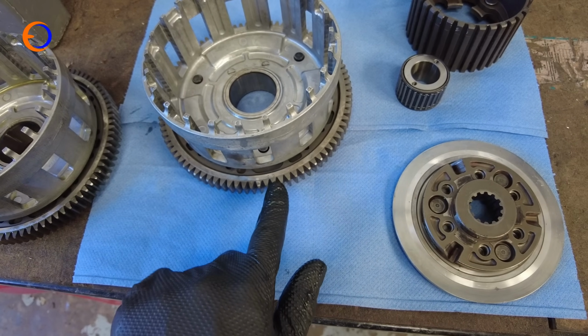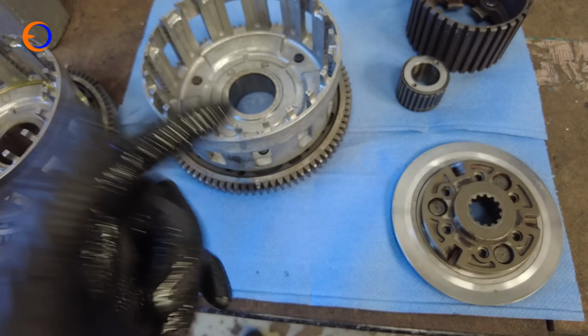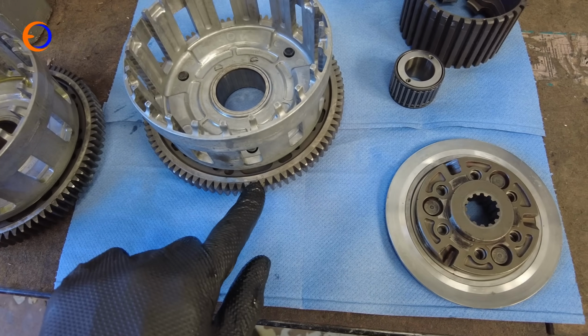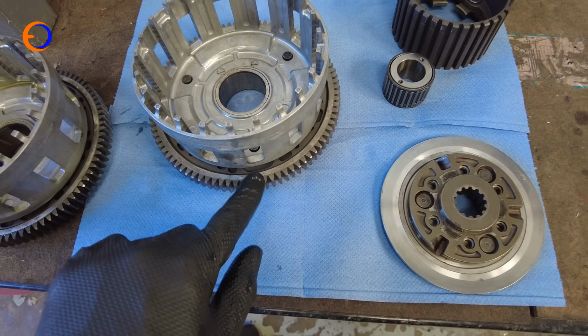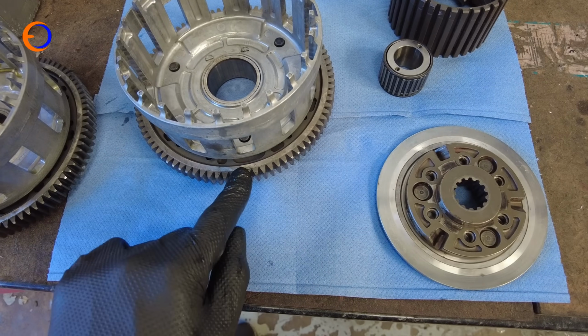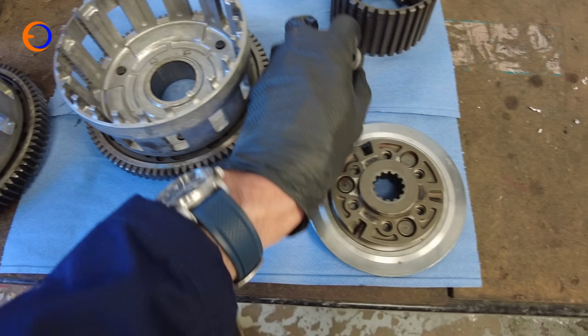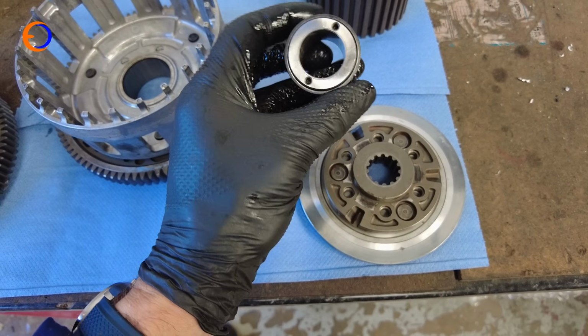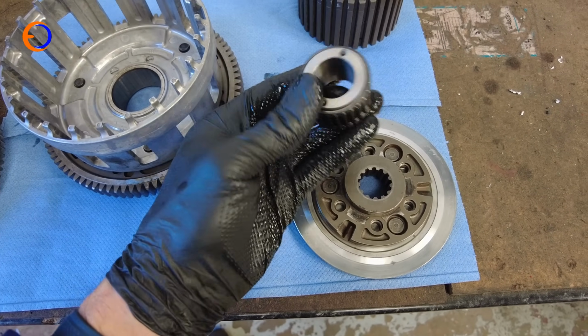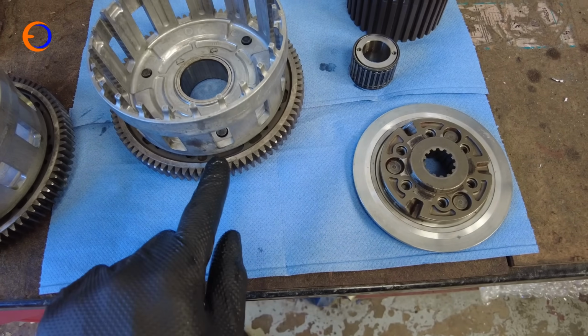So if you have an A or a B, there'd be too much play and it'd rattle, and we don't want that. If, for example, you had an A generator and tried to fit a C, it wouldn't fit, it'd be too tight and it'd wear everything out. So we needed a C. The 2 actually relates to this bearing that sits inside it, because they came in slightly different sizes. So there were 3 sizes of bearing and 3 sizes of gear mesh.